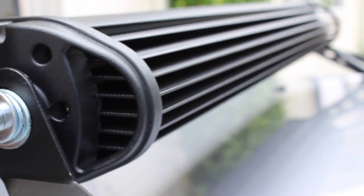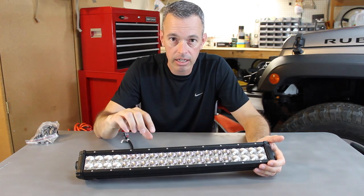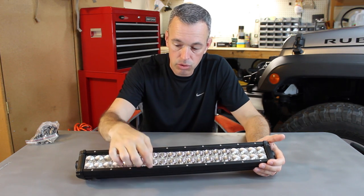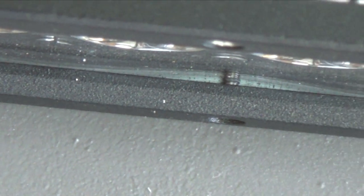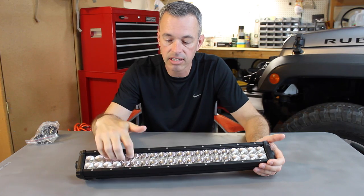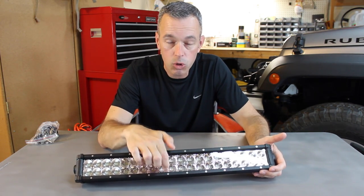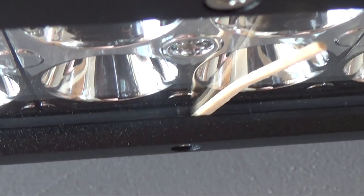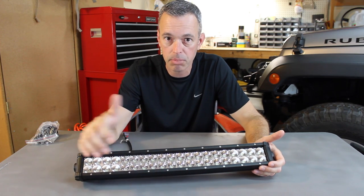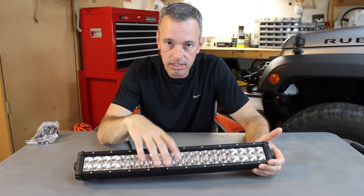It's got a lot of fins for cooling. The lens is pretty solid. However, taking a look at the light bar, these screws are screwed right through the frame and are sitting and resting on that light bar, and you get those divots on the lens. That's just not a design I like. Plus it also leaves a little gap — I mean I can stick a toothpick in between the lens and the frame where that screw is. That to me means there's going to be water, dust, and debris that might actually build up in there. Now I think they've got a pretty good seal on the lens so that may not be a problem, but that's a little bit concerning to me.